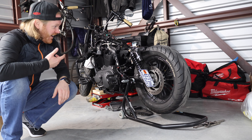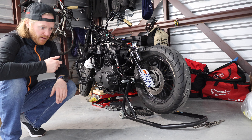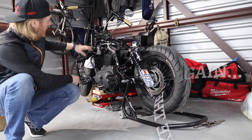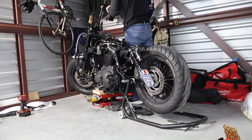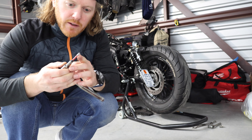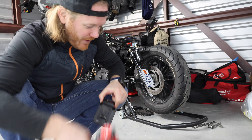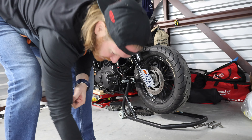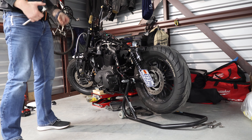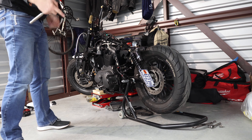I'm using a pretty heavy-duty impact driver to try and get this last bolt out — I found one more T25 Torx just in case I break the bit again. I tried it with the socket wrench T25 and it's literally twisting the T25s to the point where they break. Plus side is the Loctite's doing its job. These bikes vibrate so much. My only option now is to drill this out with a drill bit, then grab it with a pair of pliers, twist out the stud, and just buy a new bolt.